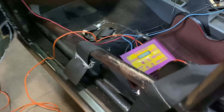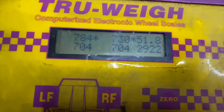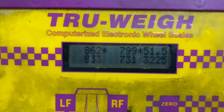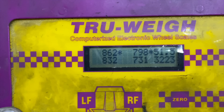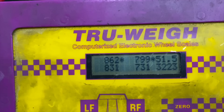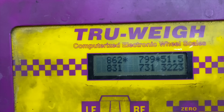So we've got this thing on the scales. It is a pig with me in it. 51 and a half percent on the front though — that is pretty doggone close to what I was hoping it was going to be. So Brian's about to hop under there now and play with the anti-roll bar. The right rear needs to be just a tad longer, so he's going to watch what it does to the scale. He's going to extend the right rear anti-roll bar and we're going to be able to get this thing pretty close from side to side. Weights in the back — watch what it does.